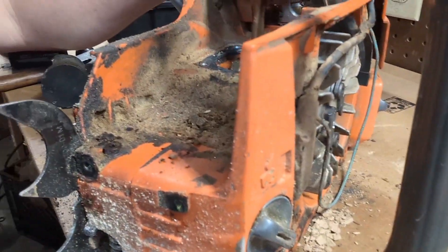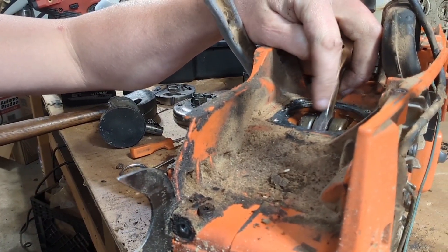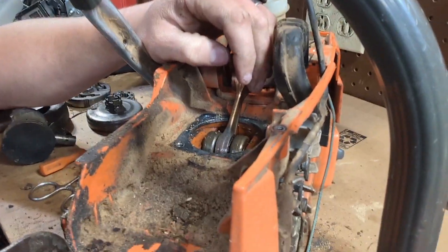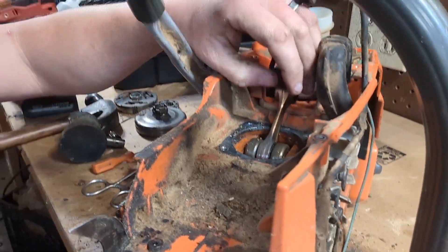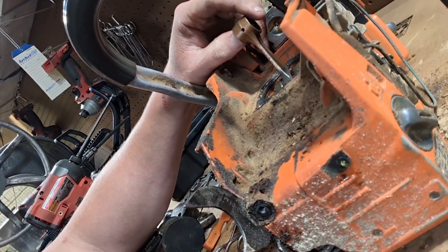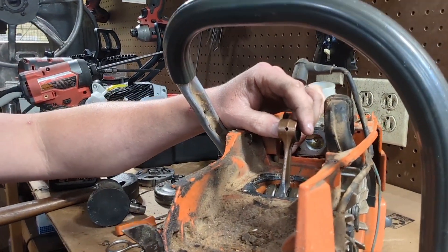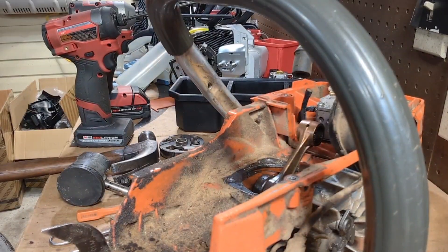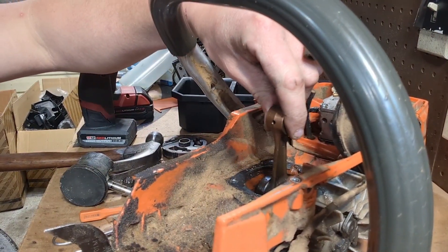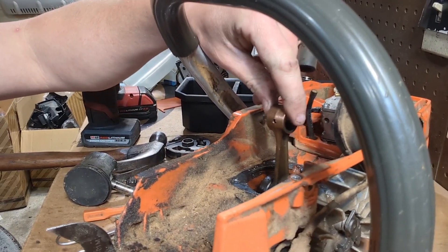The skilled eye is going to know right away there's something off with it — that's the coloring. These cranks will sometimes get a little bit of color to them, but they shouldn't be just painfully discolored like that. Now, when you're looking at crankshafts, they can move laterally on the pin and on the bearing — that's okay.